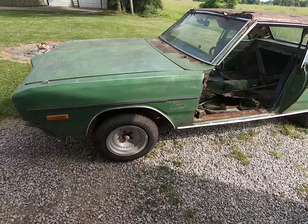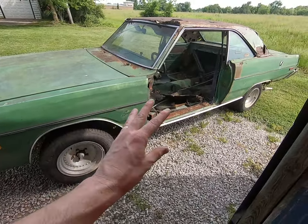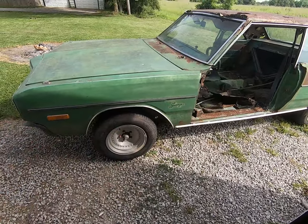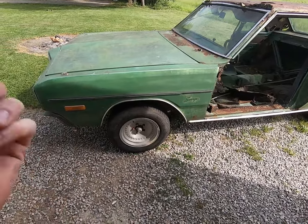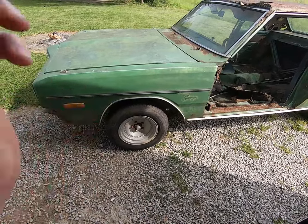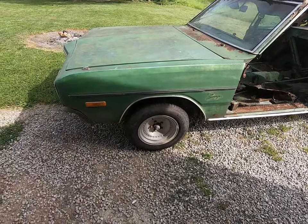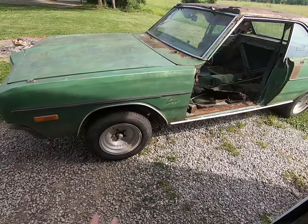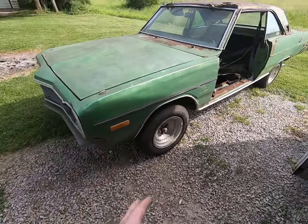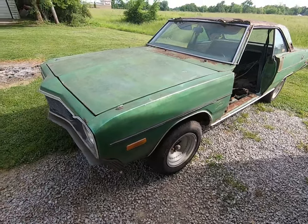In most of these cars — not all of them had disc brakes. If you had a car that was a drum brake car in one of these '73 through '76 models, you'd have a small bolt pattern. There's a lot of misinformation saying just because it's a '73 everything went big bolt pattern — not true. They kept the small bolt pattern if it was not a disc brake car.